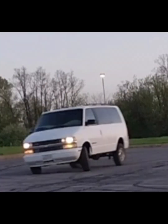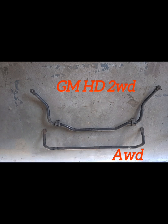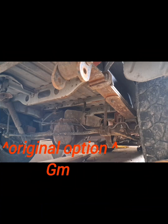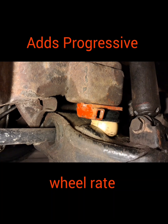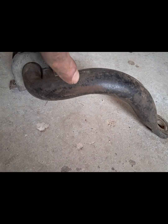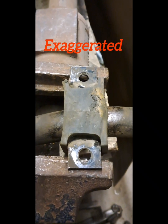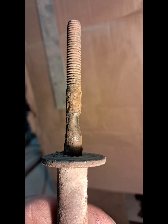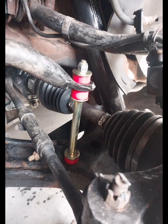While there are several options for the two-wheel drives, including a heavy duty version from the factory, for all-wheel drives we can use torsion preload to make fine adjustments. A rear sway bar can be very beneficial due to the live axle's naturally higher roll center without limiting travel. The compressive resistance of extended bump stops can also help improve handling. Wider tires or more back-spaced rims will cause rubbing on the sway bar. The frame mount bushing occurs on a bend in the bar, which results in side-to-side loading of the bushing and shift of the sway bar itself. Broken and bent end links can be common, and some aftermarket companies will use a larger diameter bolt — this may further limit travel and increase stress on already weak parts.